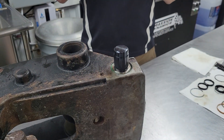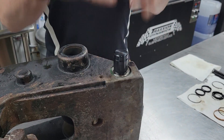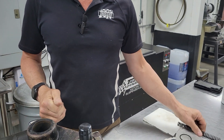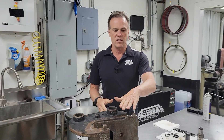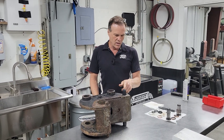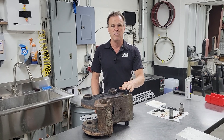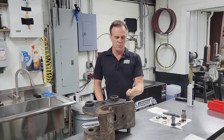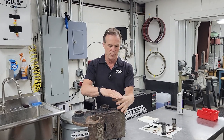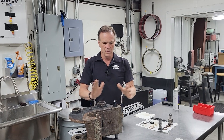It may be possible that it won't just pop out, because what's really there is just the pressure of this spring — so it may not actually just pop out. I retracted the press slowly because I was not certain as to what was going to happen. I was replacing these pistons, so I took a pair of channel locks and just wiggled it, and the spring pressure would push up on it. I raised the press a little bit just because I wasn't sure what was going to happen. Turns out, no incredible danger. Once you get this bearing to start coming out, the spring pressure is mostly off — it's not super dangerous or life-threatening.